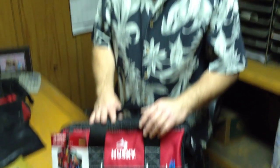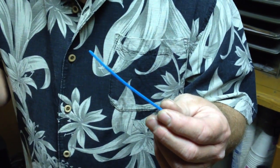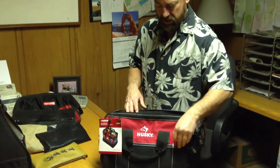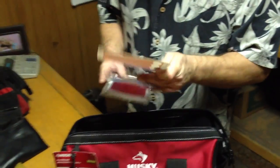The third bag of tools on this truck has your screwdrivers and other things for leveling machines. I keep a number of things in here. I put zip ties in all the tool bags — they're useful for tying up wires inside a machine if something comes loose and looks like it could get caught from the door opening and closing or shelves moving. I can just use a zip tie to take care of that. I also put stickers in for keeping track of the levels of products in my machines, which I find very useful.